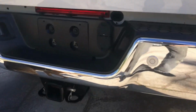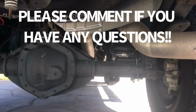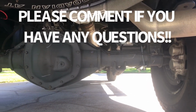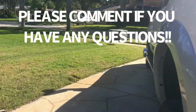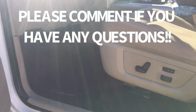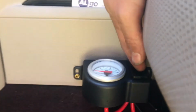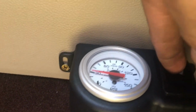Alright guys, we're all done with the truck. We have our airbags installed. I had them inflated to 30 psi just to leak test everything. It's been sitting for about an hour. Everything is run and plumbed up. The driver has full control at his switch for whatever he'd like to do. Let air out, air up.